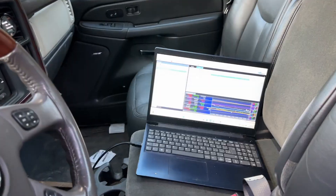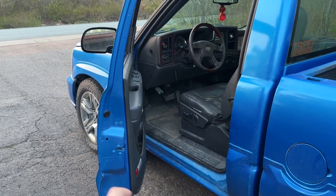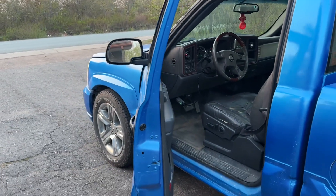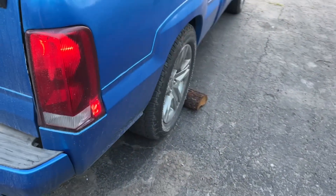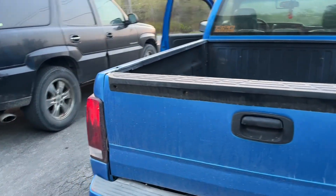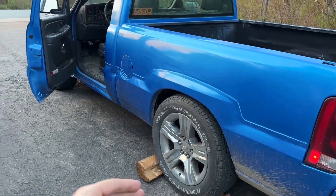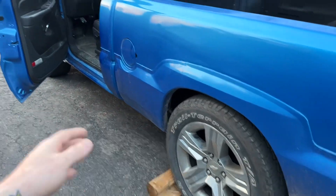That should make it run a lot better. While it's writing, I'm going to jam a couple of chunks of wood under the tires because I need to put this thing in gear and I don't want the brake on — I don't want to load the engine up and maybe skew the results. The brakes are applied by power steering because I have hydro boost, so I can see that loading the engine. I've got two pieces of splits behind and in front of the tire here and one more over here. Basically, the cam in this truck is not going to apply a lot of load just in drive because it's got a 3200 stall and the cam doesn't make a lot of torque. Also, because of the way the truck idles in gear, it kind of lurches, so I want to keep that tire stationary.